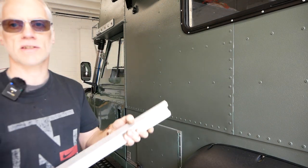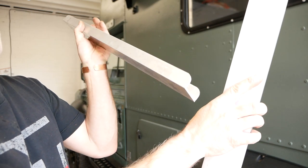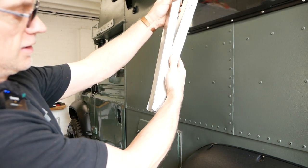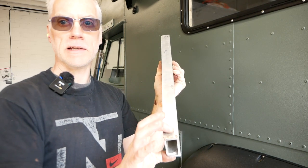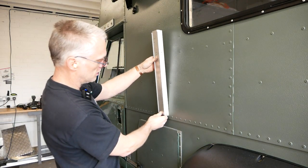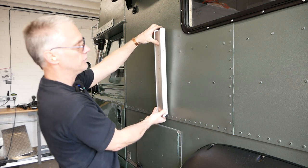This piece I've just spent a few minutes filing, and can you see that? Yeah, you should be able to. And rounding the edges off, just so that it will pivot when I drill it. I'll put it on the pedestal drill and I'll actually go straight through in one go, so like line boring it, but with a pedestal drill. If I'm shouting, guys, I've got earplugs in, I'm sorry. But yeah, so that will do with the table on. So I'll just go and file the other one up and we can start drilling these out. As I'm choking to death, there we go.